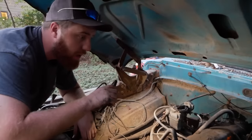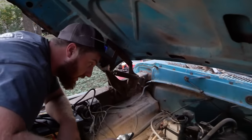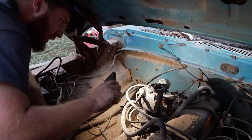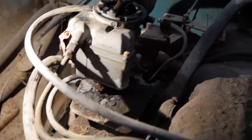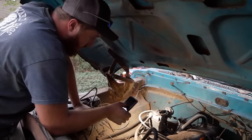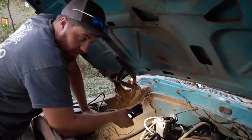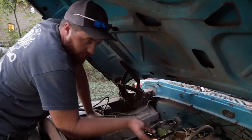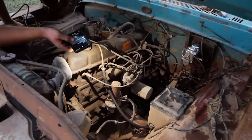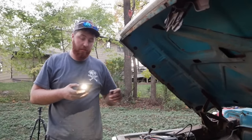Okay, got our electric pump hooked back up. There's another goddamn train. No brakes. For whatever reason, when I turn the pump on, I get fuel absolutely just running like a river down here. So, I don't know what that's about. I'm sure that'll go away, right? I popped our carburetor top off, cleaned off our needle and seat. Like I mentioned, we've disconnected the tank and the pump, so that should not be a problem anymore. We're running back off of clear, clean fuel.